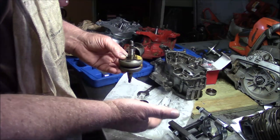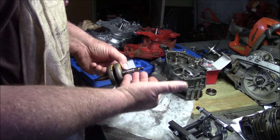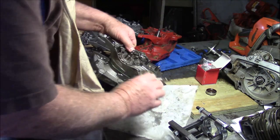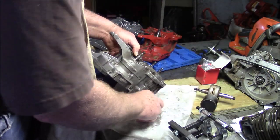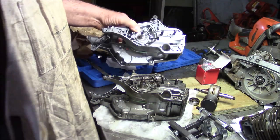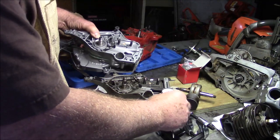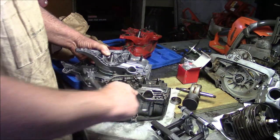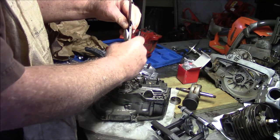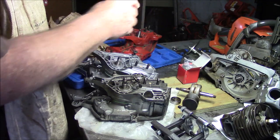Both cranks have stuffers, whether it's a 560, 2260, or 562, but the large mount case is different. So the crank has a longer section right here where the clutch rides on to move the clutch to the proper location. So when I was measuring, yeah, this is the 562 crank, and this is a 562 set of cases, and this isn't. This is a 560, and again, here's your small mount, there's your large mount, but also the stub is different because the distance from this flat plane right there to the bearing is different. So the stub on the 562 is shorter by about 100 thousandths.